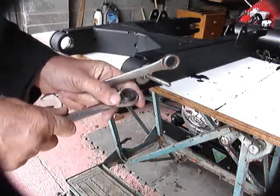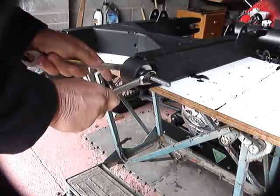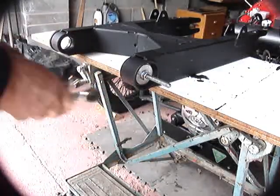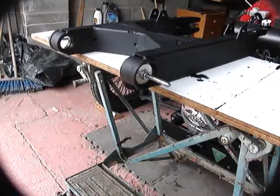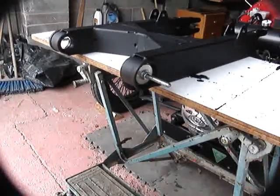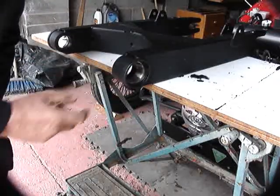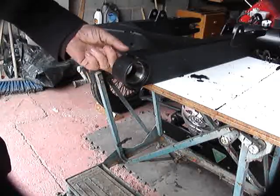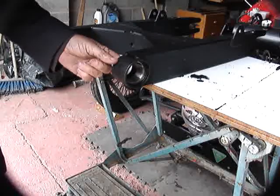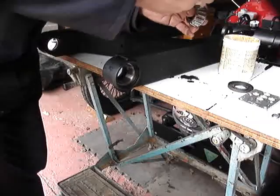The outer race is now pulled all the way back in. Make sure you pull the bearings all the way in - give them a really good tighten up with that stud when you pull them in. If you leave them slightly short and they bed down later on, you'll end up with rear wheel steering, which nobody wants.